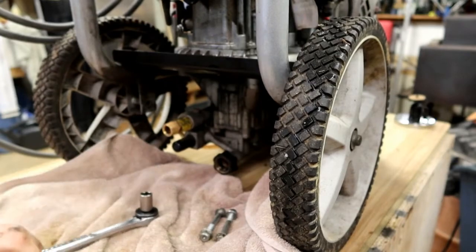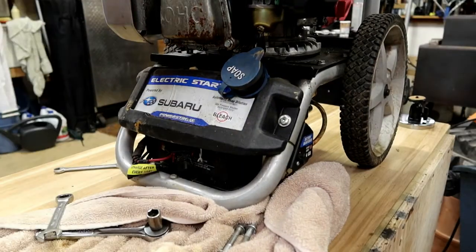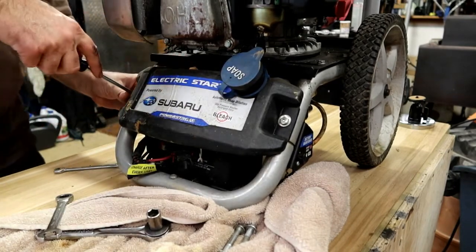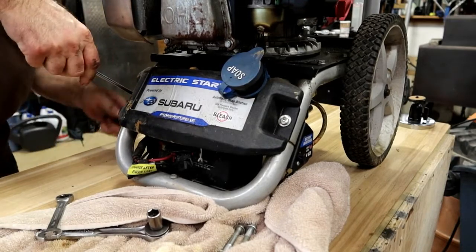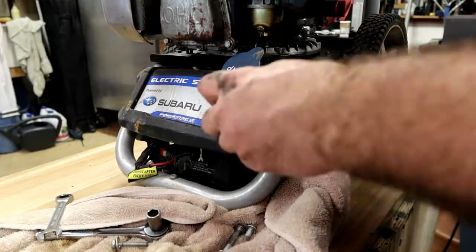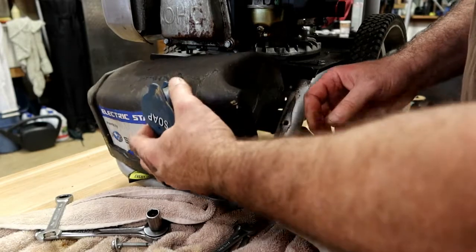And we got one on the front. Let's access the one on the front. Let's take off the pump. To get access to that bolt, we gotta use a T30. T30 on that side, held back by a 10 millimeter nut on the other side.